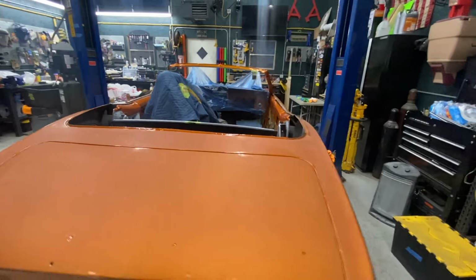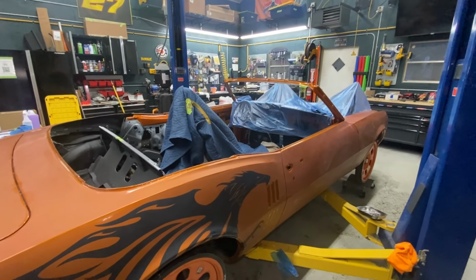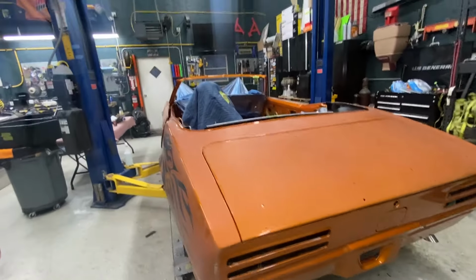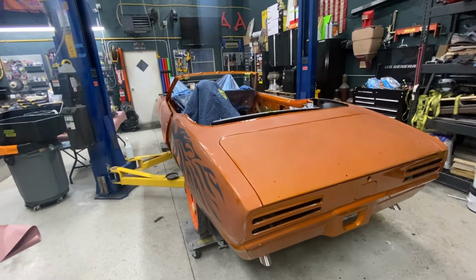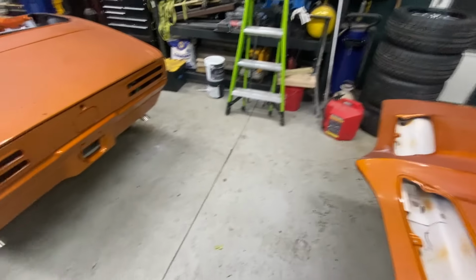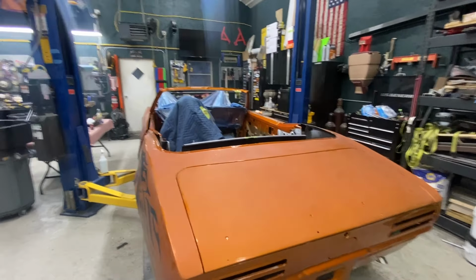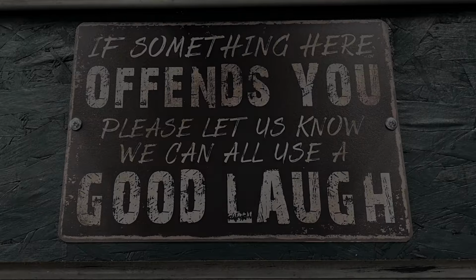But I'm going to end this video here, and the DA work and then eventually the buffer work will be follow on. So yeah, that's pretty much how this goes. It's just a lot of sanding. I bet I've got close to 8 hours of block sanding, just block sanding this. So not a small task. So anyway, we're going to move on to the next step. I'll start DAing this out with the wet sanding with the really high grits, and we'll see how that looks.